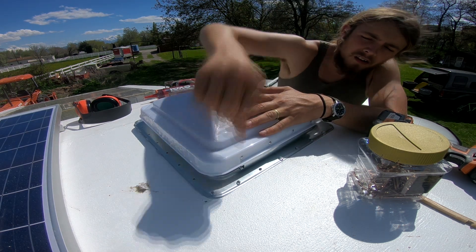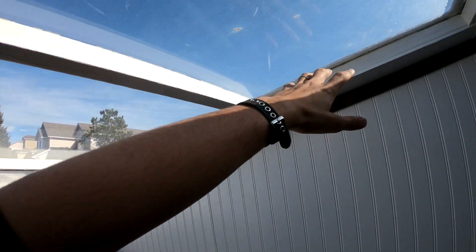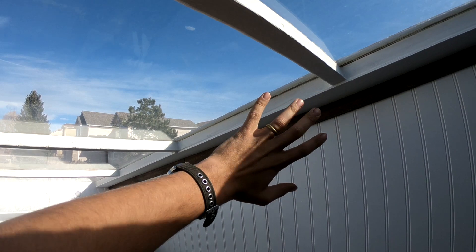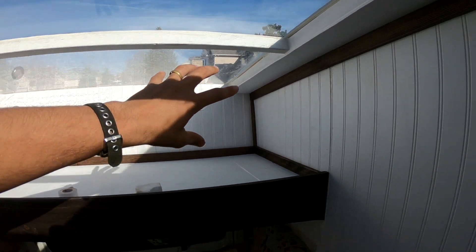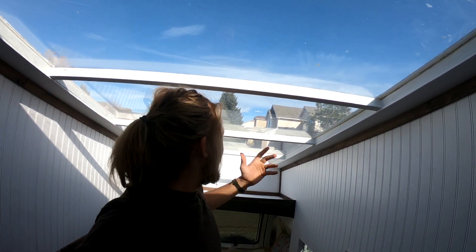That's going to conclude my part two of making this awesome roof. I still got a little bit of cosmetic things to do, but I'm very happy with the final product. I made some changes — I had some issues at the start with those leaks. What would happen was water would get in somewhere up top and then because of the internal caulking, it would flow down and leak right at the very back. I actually replaced the back panel once because I got a little bit of water damage. But I haven't had any of those issues since I switched to the marine adhesive. I'm now confident it's not going to leak and that it's strong. When I started this project I wasn't too sure what I was getting myself into, but I'm very happy that I stuck with it. I don't think I've seen anyone else do something like this, so it's kind of one of a kind and I'm really happy with how it turned out.